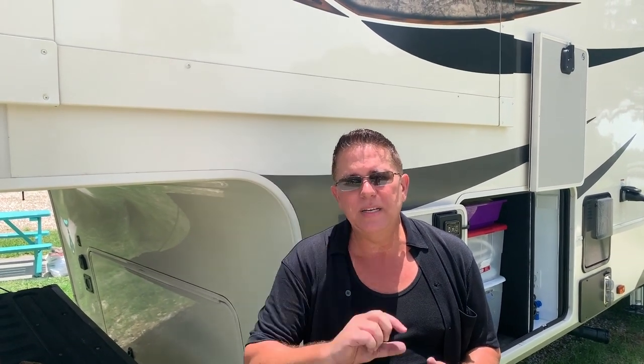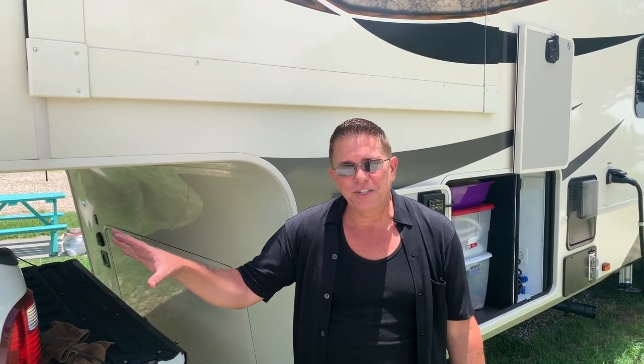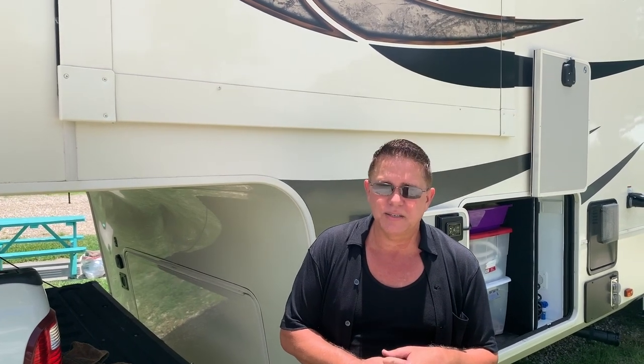and now it's really important that you do what's called the pull test. So I'm going to get into the truck, I'm going to engage the trailer brakes with that little squeezy thing, I don't even know what it's called, but engage the trailer brakes, drive very slow, and when you feel it tugging, that means that you're hitched up, everything's engaged and working properly, because if by accident the truck did disengage from the hitch and you drove away, the rig is literally just gonna fall like an inch to the ground and it's not gonna crash on the back of your truck. So again, it's just a safety test to get yourself in practice of doing, and it's called the pull test. So I'm gonna get in the truck and we're gonna give it a little pull.